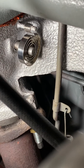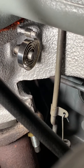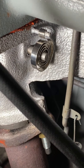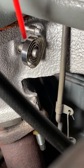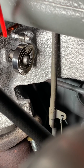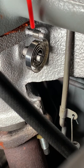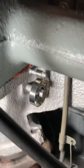As you can see, it turned the valve — that simulates the heat, the engine heating up. Then I got this can of ultra duster, it's just basically compressed air, so I'm going to spray this on that and then you can see it release. It took me a little while to figure that out, but hopefully that helps someone out there.